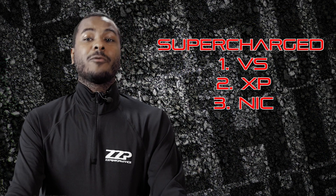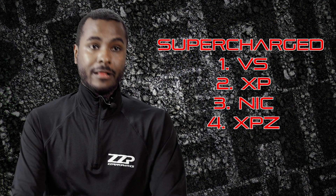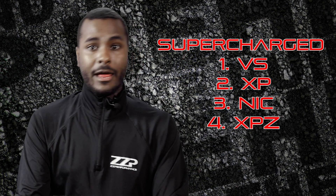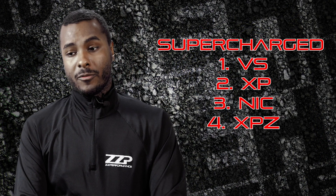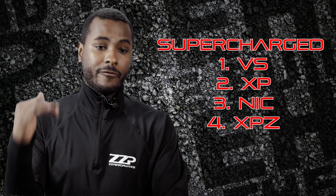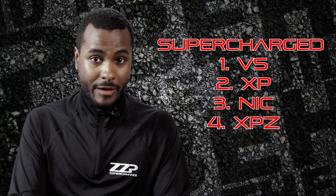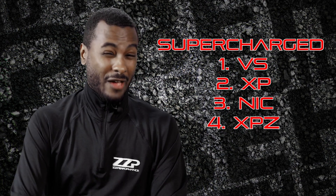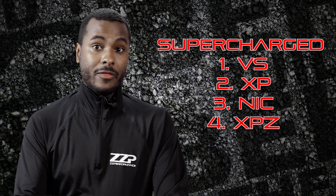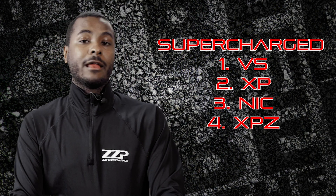The next and final cam for supercharged guys is the billy badass one — our XP Z Cam. The main thing with this cam is that you really need ported heads to see the gains. It requires pretty much the same valve train mods as the others, though your push rod length may need to be different depending on your setup, and you may need at least 150-pound valve springs and retainers. This cam is for when you're trying to go all out, run the fastest times possible, and give the car everything it has. This is the same cam Zoomer used to run nines — pretty much every fastest record is on an XP Z Cam. Preferably aluminum heads to make this cam run exactly how you want it.